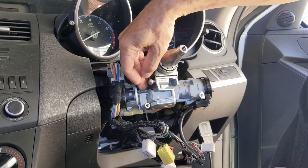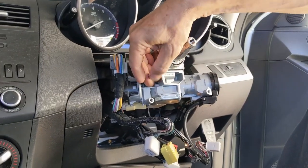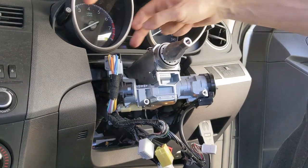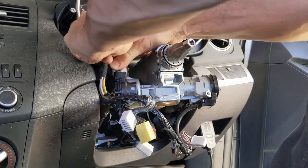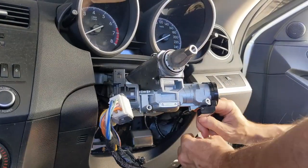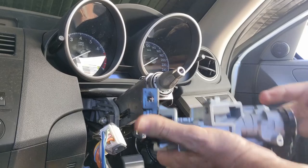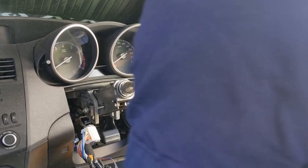In the previous video I showed you how to get off these security lock nuts, these security bolts. So once I've removed those, I can remove — there's one there, there's one on the other side, and before the video I'd already removed the one on the other side. I'm going to remove the ignition switch connector — I broke it, oh well — and I'll have to disconnect the transponder connector. Then I can remove the whole housing. So there's my housing: the key barrel, key barrel housing, and ignition switch.